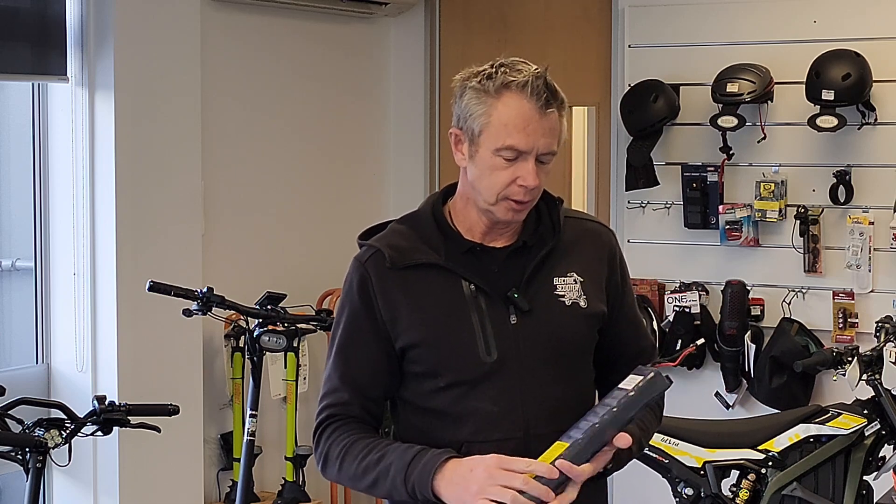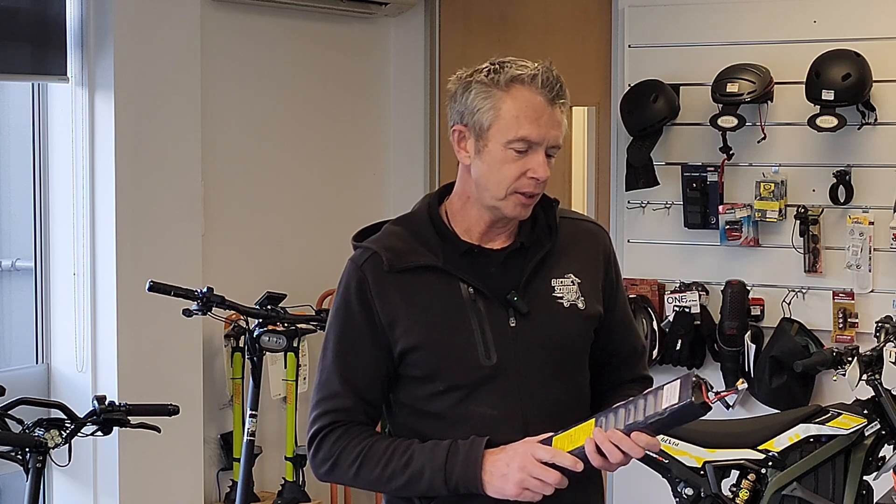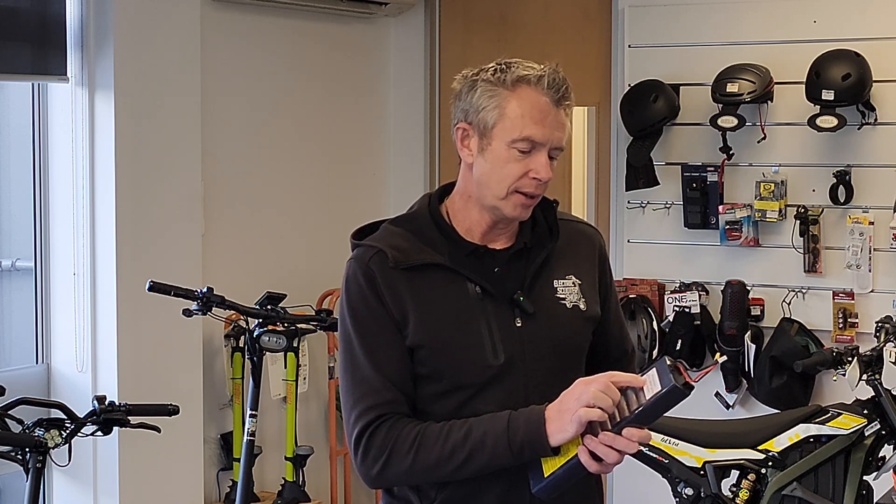Let's look first of all at what a battery is. Batteries come in a big rectangular block, and inside you'll see a number of different cells that look very much like AA batteries. These cells are spot welded together in a lattice connecting network, and they have a BMS — a battery management system — installed in that pack as well. These batteries have a label on them that will turn red if it touches water, as this one has here. This has been water damaged and has come out of a defective scooter, just to give you an idea of what a battery looks like.